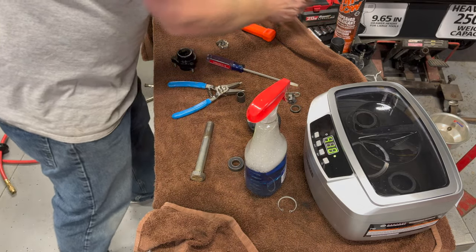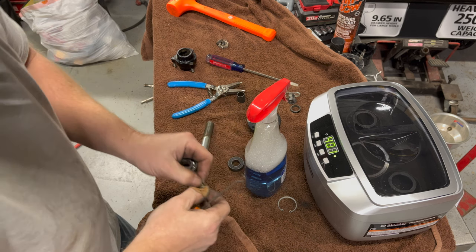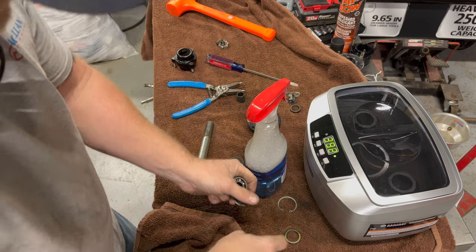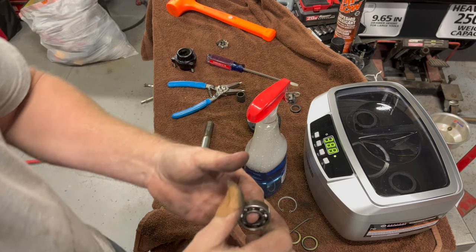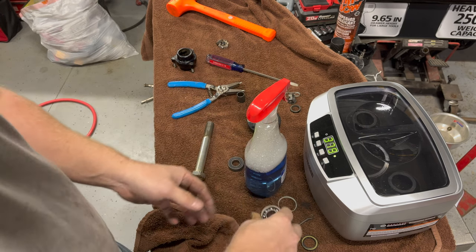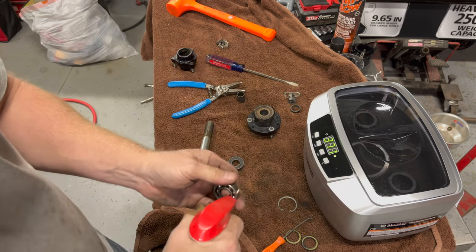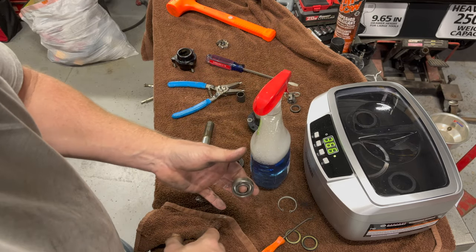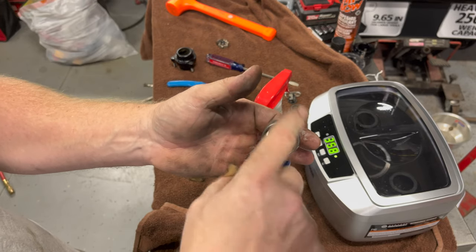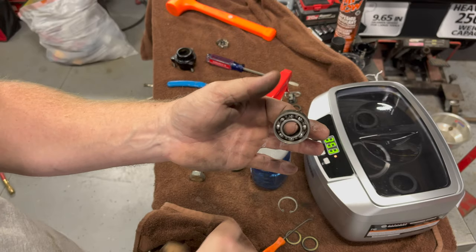And then the same thing, take a little pick. Pull that apart. Now when these come in, they're full of grease. You just brake cleaner, brake cleaner, brake cleaner, get them cleaned out. I've actually had to just put brake cleaner in a cup and set it in there so it would soak and break it apart. But it feels like there's still grease in it. There's no dirt in it, and they're not rusted. See, that's how free it should spin. So maybe there was some little dirt in there, or some grease that it broke up. But you get these clean with all the grease out and the right TriFlow and WD-40 mix or whatever you put in there, and they're amazing.